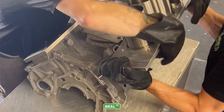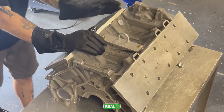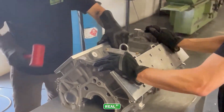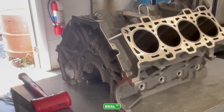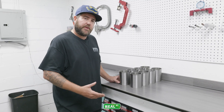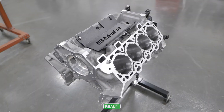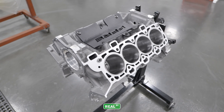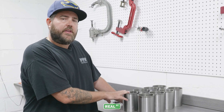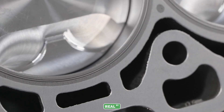After installing all four sleeves, we put a torque plate on the block and torque it down, which seats the sleeves fully. We let it settle and come to temperature. The next day, we take the torque plates off and mill the block completely flat. After that, we bore the block to the final internal sleeve dimension — which is the factory bore of 3.630 inches. All of our short blocks get bored back to the factory dimension. The final step is O-ringing the deck: we machine a groove in the top of the sleeve to accept an O-ring that works with the multi-layer steel head gasket.